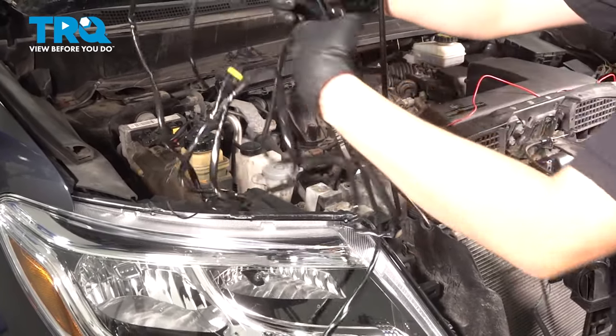This yellow wire that goes into the car, we're going to run back up on this side. The wiring harness is designed so that you connect it here, loop it around to the passenger side, connect that fog light, meanwhile it goes through the fuse and relay, feeds the other fog light, grounds out, and then goes into the cab so you can power it all up with the switch. On the passenger side I have an excess of wire, so I'm going to take a wire tie and secure it onto this other harness here. Follow this wire harness along and wire tie it here and over here so it can follow the rest of this — this is routed here from the factory, so this is where Nissan wants it to sit.